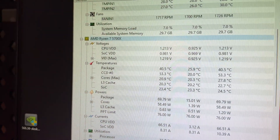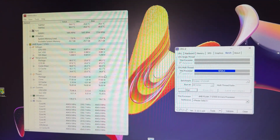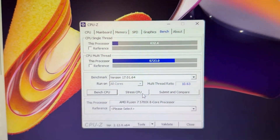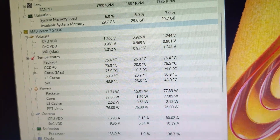After plugging the cable into the CPU fan header, I ran a variety of stress tests and we can now talk temperatures. This thing is surprisingly good. Idle is in the 30s, which is expected from any cooler. For a standard CPU-Z benchmark doing multi-core and single-core, the maximum temperature was in the 70s — extremely good. A note on test conditions: I tested at fully stock settings, and it's winter in Italy so ambient temperature is 15°C. If you're running at 25°C, add 10 degrees to my numbers. The CPU-Z stress test stabilized at a maximum of 75°C all-core.